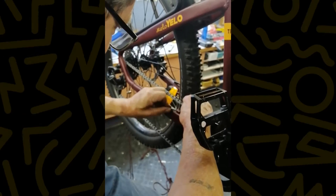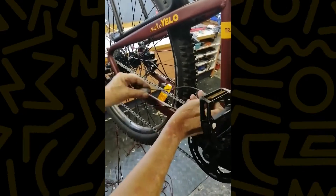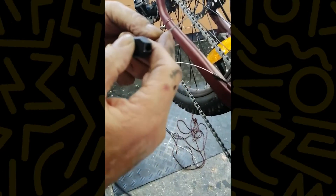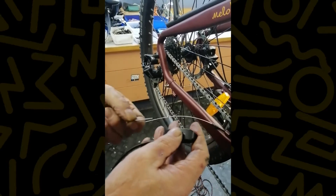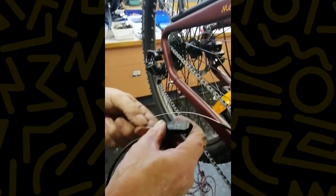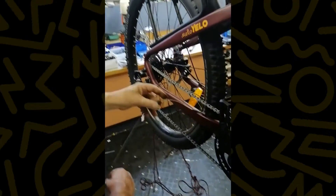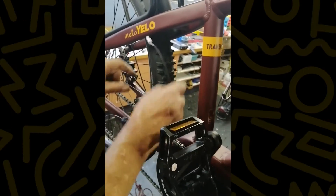Make sure it's pushed all the way home. Mind you, the first time you change the gears it will push it all the way back. Then you put your gear sensor on — this is always tricky. I want the cable facing towards the motor to get the maximum length. To feed this in, because it's a rubbing system it's quite tight — that's why I put glue on there. Look at which way the cable is twisted so when you push it in you turn it the same way, so you're not going anti-twist. There it's got through.